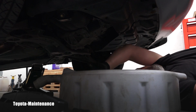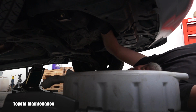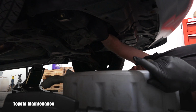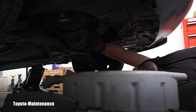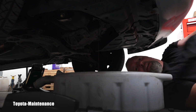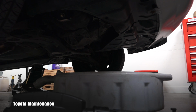And I think I'm lucky. The previous technician did a good job. Yes, I can loosen it by hand. This is fantastic. And I basically don't remove it completely, right? I just loosen it like 2 or 3 turns so the oil can start draining out of it. You will see it dripping. See that? And then I will wait until it stops.